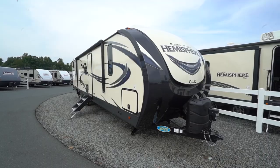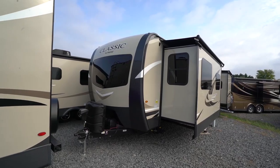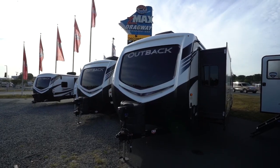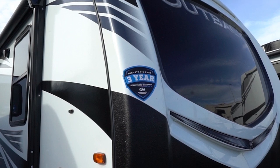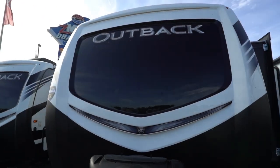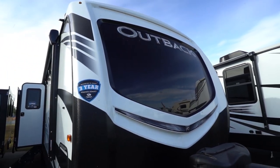The last one is a true front cap, and a lot of your high-end quality travel trailers, this is what they had — but more and more are going away from it. What the true front cap actually gives you is protection from water intrusion. Rather than having the seals right up front, it actually wraps around to the sides, making it much more difficult for water to get in. It's also a thicker fiberglass, meaning that it's more rigid and stronger up front. But a lot of people just don't see the value, and so we see less and less front caps.